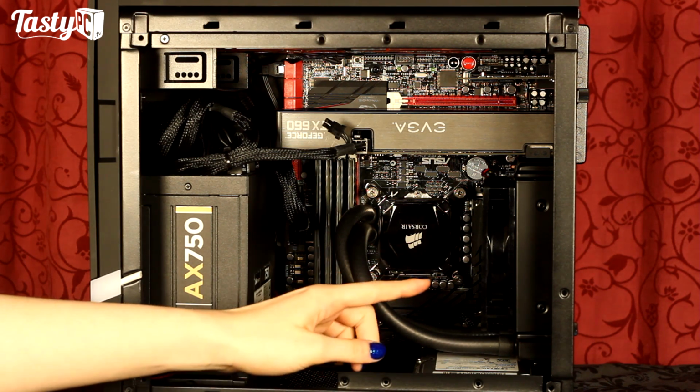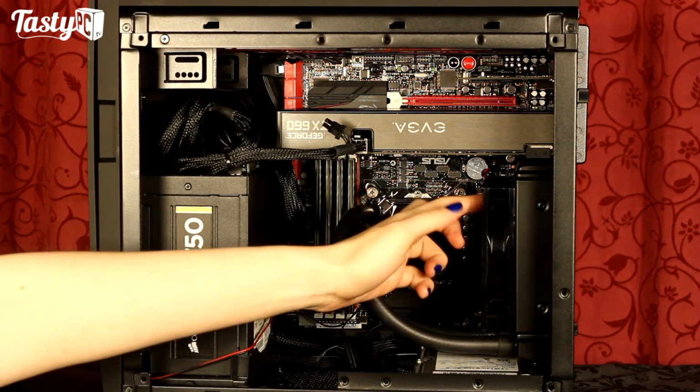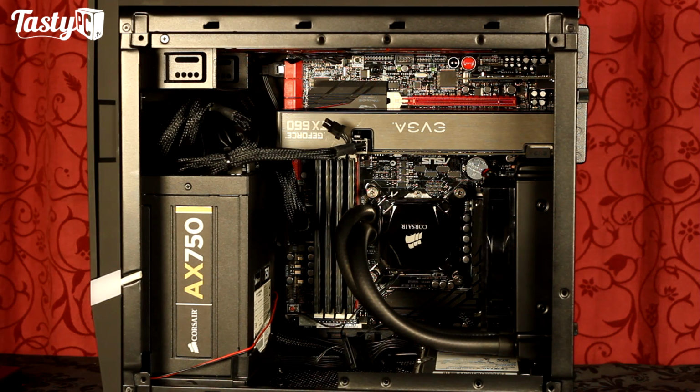In the rear of the case, you can fit either a single 120 or 140mm fan or rad, and here I fit a H80 because I wanted both of the rigs to be as comparable as possible, so they've both got all-in-one liquid coolers. Although you do have roughly about 175mm of space to work with for your CPU cooler's clearance. I have to say though that even though the Mini-ITX version of the case is really great for water cooling, you've got loads of options to work with, with the Micro-ATX case it's not really an option.